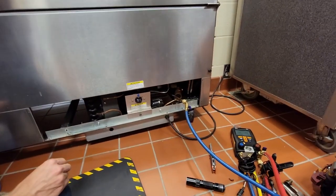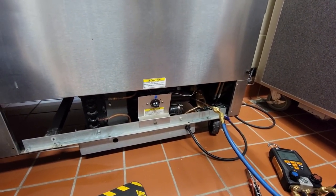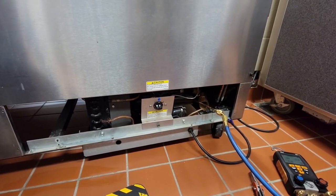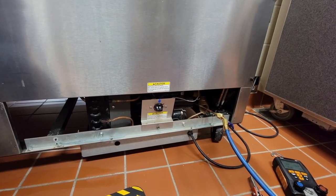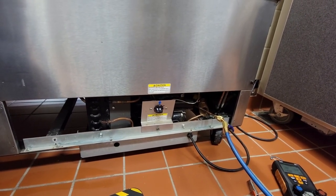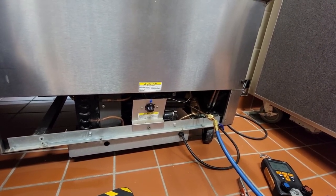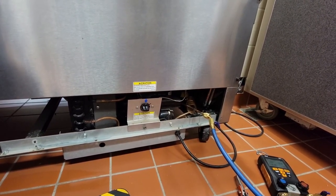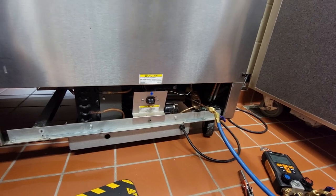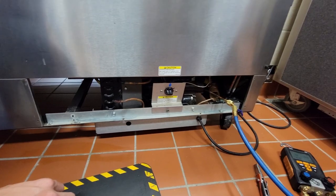Wilbur has a hypothesis - what if the capillary tube is plugged? That's a possibility because you're not going to back-feed from the condenser into the compressor, it's going to hold against it. It could have sucked it all up and pumped it in. It's not going to equalize if it's 100% plugged. I've never seen it completely plugged like that, especially if it was just working beforehand, but anything's possible. We're going to go ahead and relieve the pressure, cut that loose, put one on the high side, and see what we get.